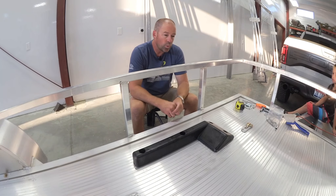As you can see, Mike was able to just back it straight on, and not only does it automatically center, but it lets him know when he's reached his final destination — which is very important because we don't have a lot of real estate to mess with right here. Another purpose for placing the chocks where we did is that if this thing's on a rough road and the suspension's collapsing, we're not tagging this front rail.